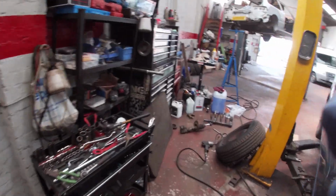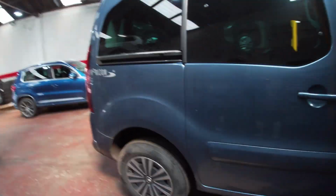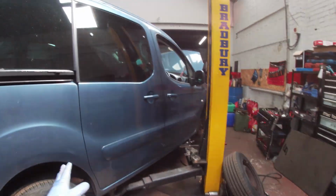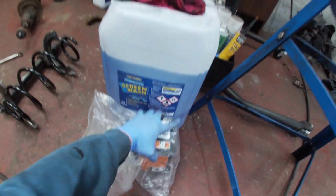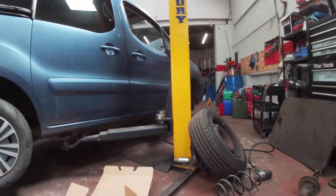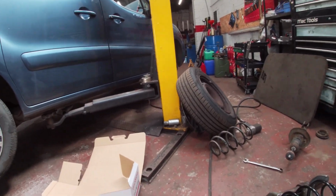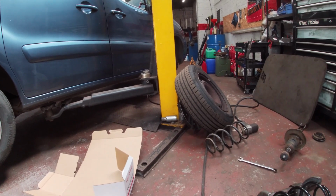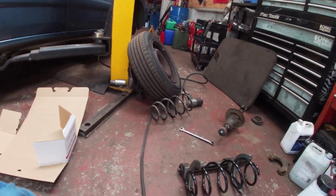So unfortunately, we had the car in because it was recovered here with the exhaust falling off. It was all rotted out. We inspected it. Could be doing with a drive shaft CV joint, which I have there, but they couldn't confirm whether it was the right one. I don't want to change it, then cut that one off or knock it off and then find out that it's the wrong one or whatever. So we are going to grease the CV joint up, but my bad.